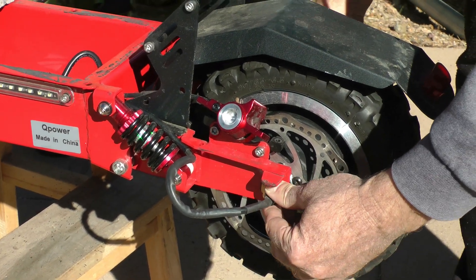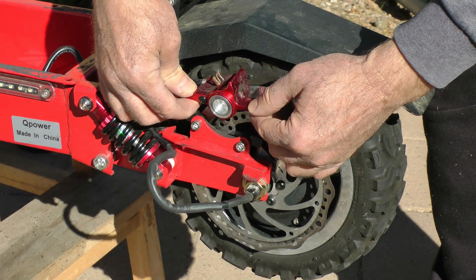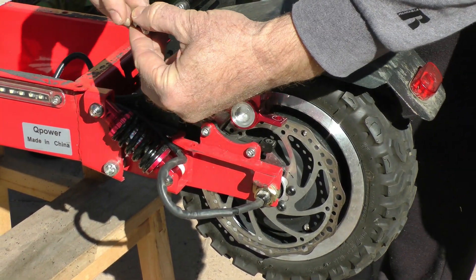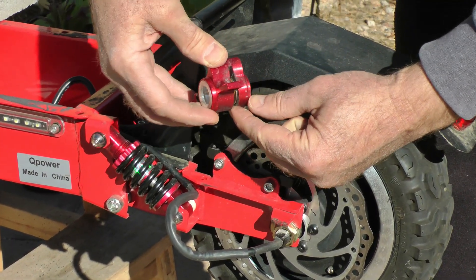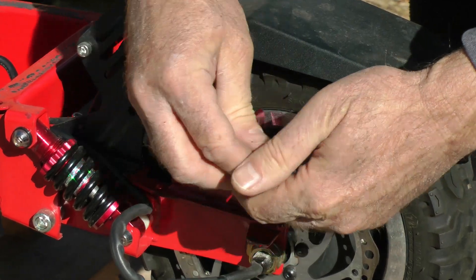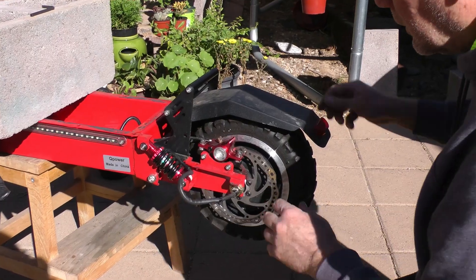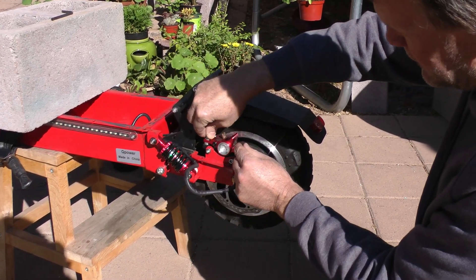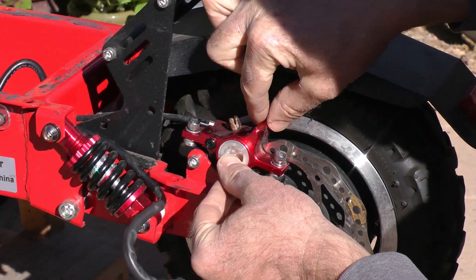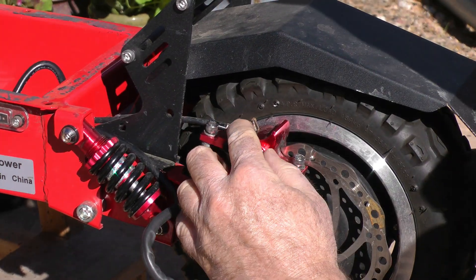So I got my nuts tightened on this axle. Without the caliper on, the wheel is just free spinning. So now it's much easier to put the caliper on now than it was to try to put the wheel on with the caliper mounted. We've got to get our hardware and basically you just want to slide — you can see your brake pads — and in between there you want to center it over the rotor so it slides down. Now we've got to put those two spacers in between the black part and the red caliper — they go in the middle, then a washer with the screw through the top. So I've got those screws and the hardware spacers in there, and I haven't tightened them down all the way because we need to adjust this a little bit. The holes that these screws go through are not perfectly circular — they're kind of oval — which gives you the ability to move the front and back end in and out.